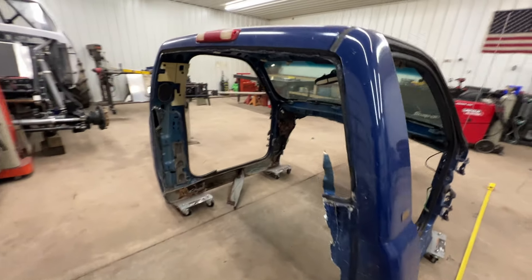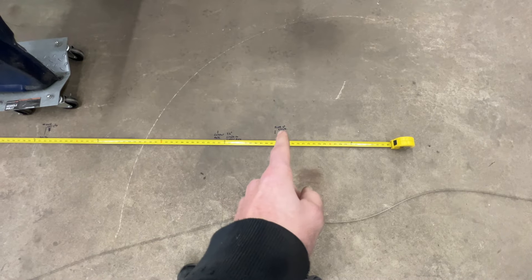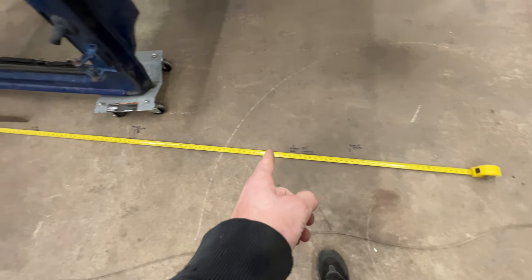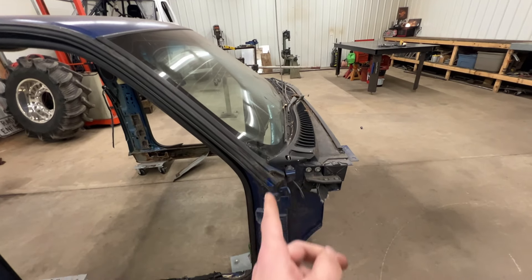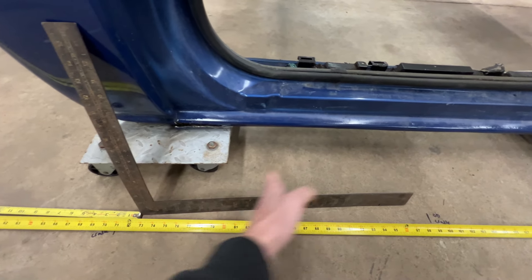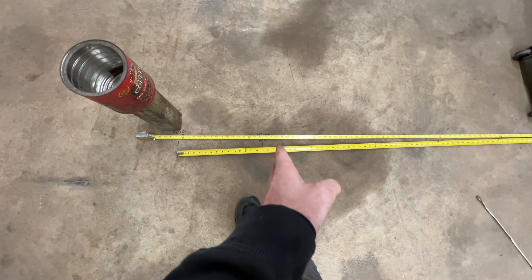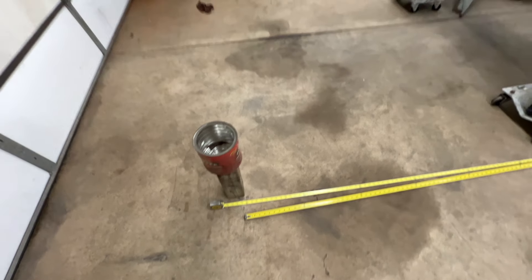I've got the cab pretty cleaned up. I still need to do some finish work and then clean everything up a little bit. Next step is laying it out. I got the truck laid out the way I want to do it. I got the front of the truck there, center of the axle — this is where my upright slash windshield bar will be, this indicates the center of my cradle, so the inside diameter of my cradle. This is where my halo bar will start, back here is where my axle will be centered, and then this will be the back of the truck. A little bit worried on this, but all you can do is do it — so I'm going to grab a piece of pipe and start cutting it up.